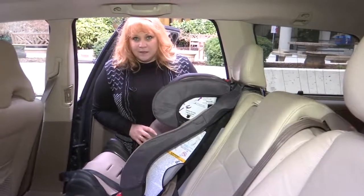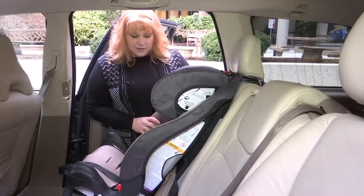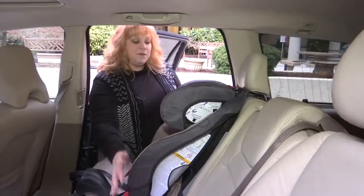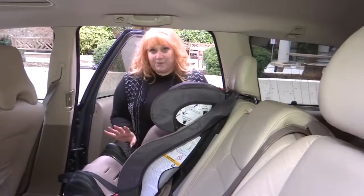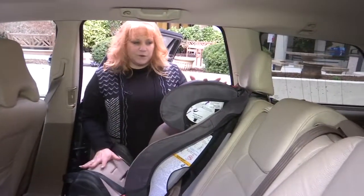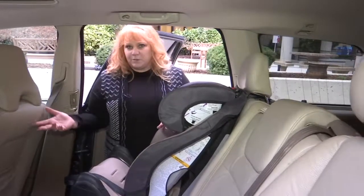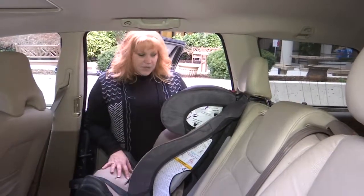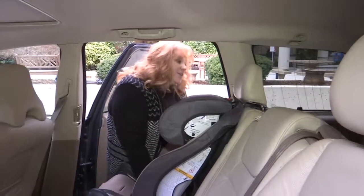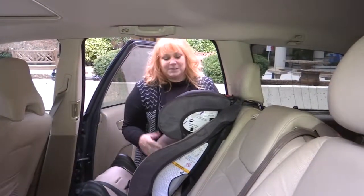So you have the seatbelt through, and the two fastens in the back are clipped. It's one or the other — you either use a seatbelt or you use a latch; you do not use both. We used the seatbelt and not the latch because we're going to assume in this forward-facing seat the child might be at least 40 pounds. We made sure there was no extra slack, we heard the clicking, pushed it in. But are we done? No, you're not done — and that's where a lot of parents make a mistake.